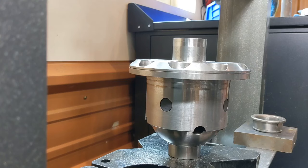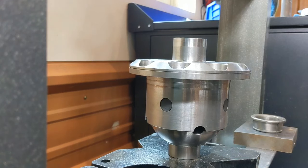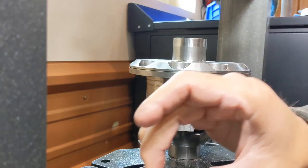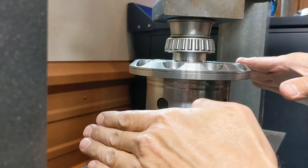When you get ready to press your bearings on, get your press all set up. A lot of people recommend putting a very light coat of grease on the inside so it presses on easier. I live in a dry climate so I don't have an issue, but it makes sense — if you ever have to take them back off, you don't want them seized on. With the ARB airlocker, I'm going to press on the bearing on the seal housing side first, then flip it over and do the other side. Make sure when you do this that the bearing is oriented the right way — you want that cone facing out.